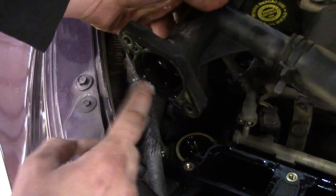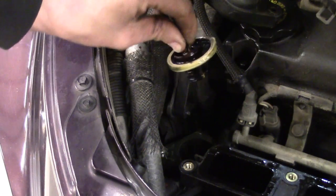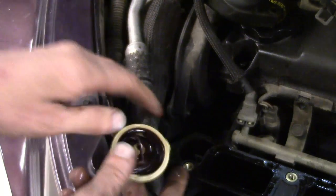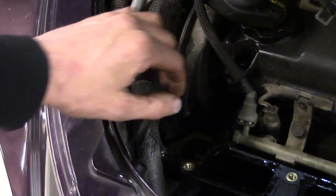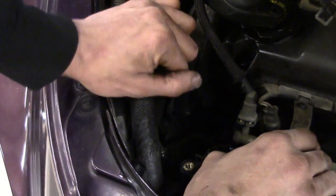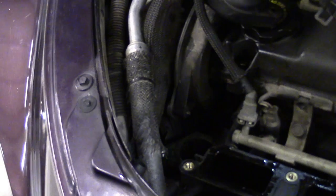The bottom of the thermostat is sealed by the thermostat itself, and the thermostat has a seal on it — and there's your old thermostat. So we're going to be replacing both the thermostat as well as the housing, and re-tightening and cleaning everything up along with the upper hose. It's not a very difficult job — it just takes a few steps. And if you want to go ahead and do your spark plugs while you've got everything apart, that's probably not a bad idea.